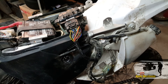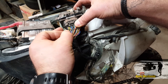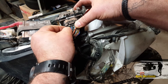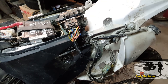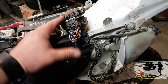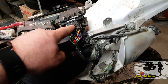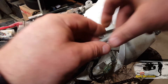The TPS wire is the pure yellow wire - no stripe, just yellow - and it's this one here. What we need to do is back-probe that, so I'm going to use a pin - you can see it there - and very carefully ease that pin past the little rubber sheath. There we go, that's all the way in, now touching the metal contact at the bottom. If you back-probe at the ECU and get a good waveform, excellent. If you get a bad waveform, you can do it at the actual sensor itself - a good one at the sensor and bad at the ECU means a problem with your wiring harness.